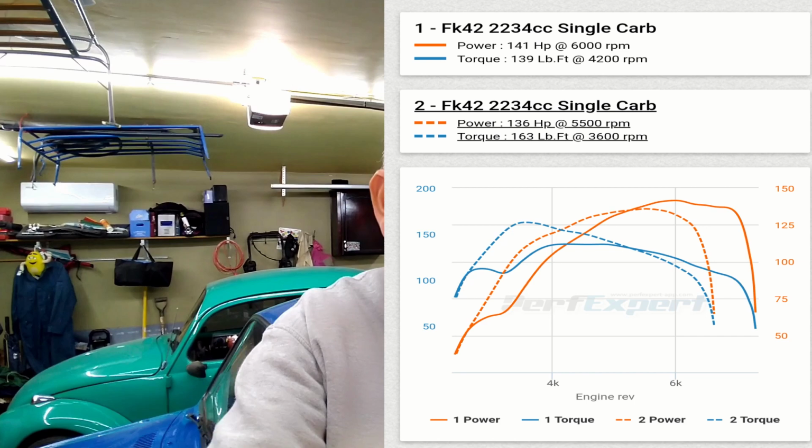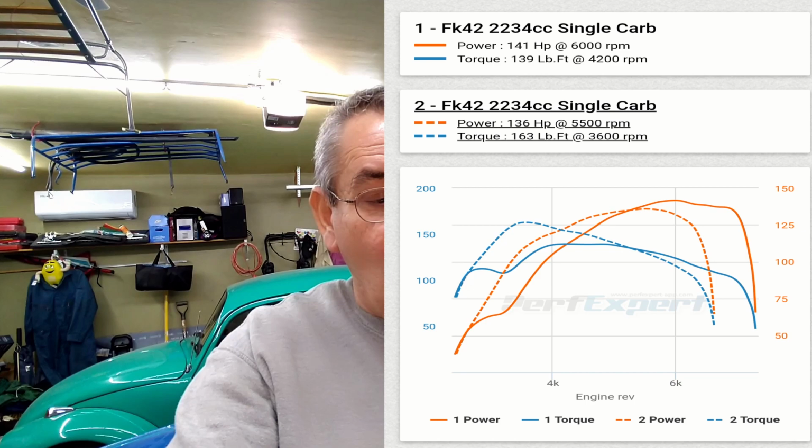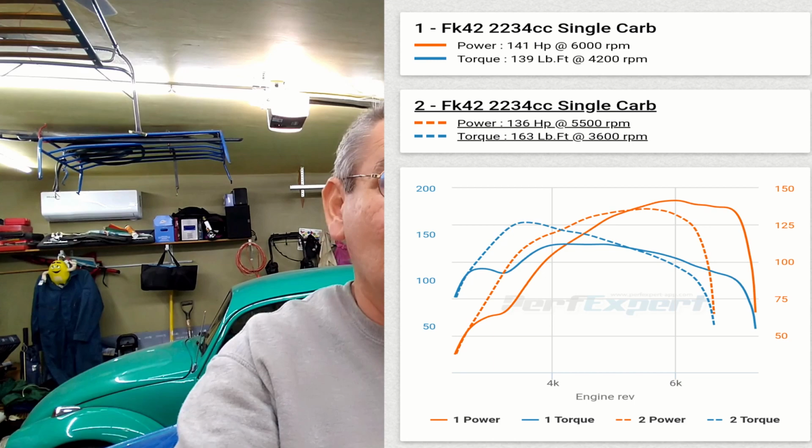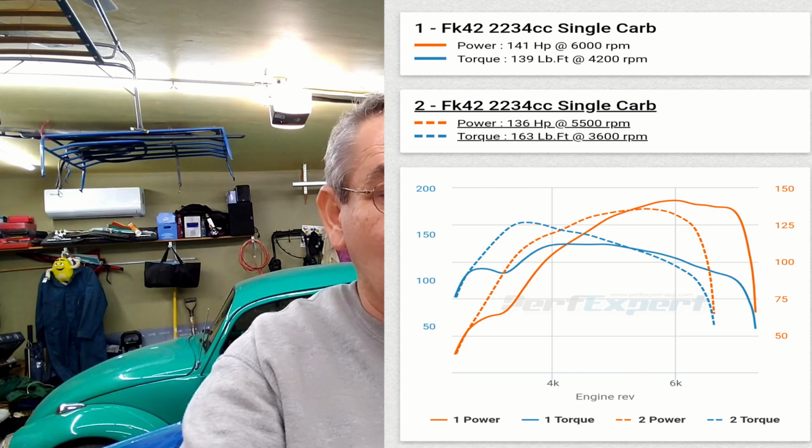But fueling is, I think I'm flooding too much fuel to the main, because at wide open throttle, when I hit 6,000 RPMs, I'm still hitting 12.40, 12.50 on my wideband. Okay, that's too much fuel. And I'm already really tiny on the main. So I'm not gonna make it any smaller. So what I'm gonna do is, like I said, I have to correct that.